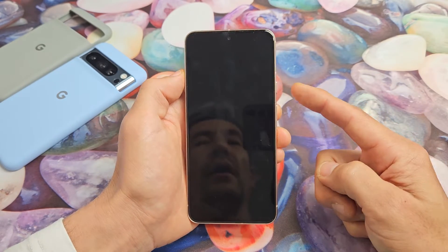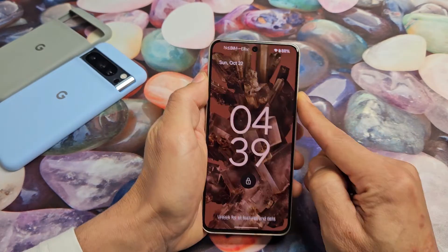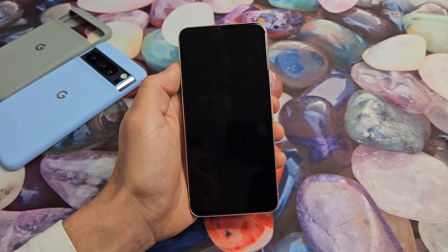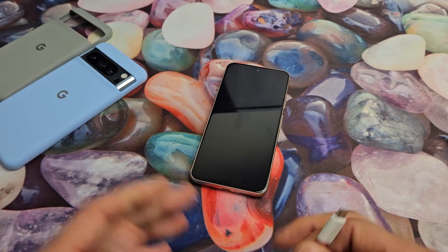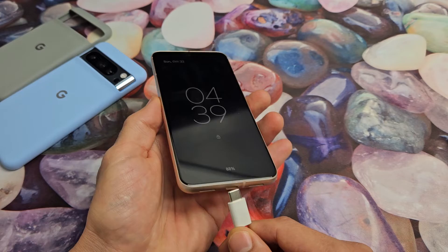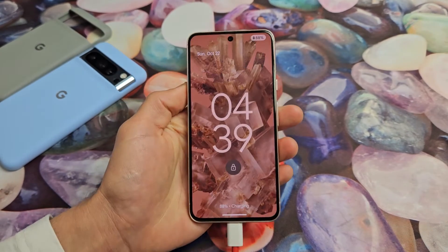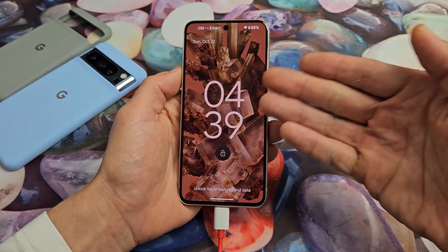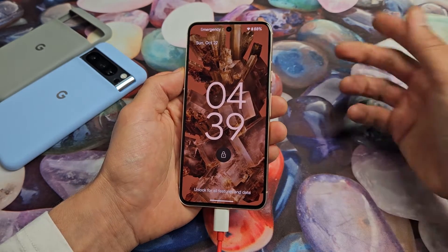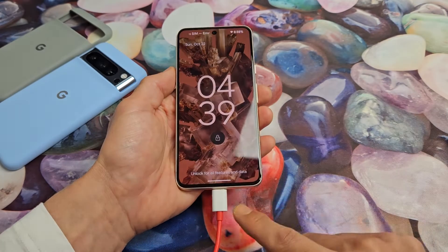So please don't do that. Power button — we're going to spam it kind of hard four times: one, two, three, four. That's it, just like that. Now put the phone down, grab your charging cable, we're going to plug it in. Give it a little bit of power. And then while it's plugged in and charging, we're going to force a restart using that two-key combination again. So pretend my phone here is black while it's charging.